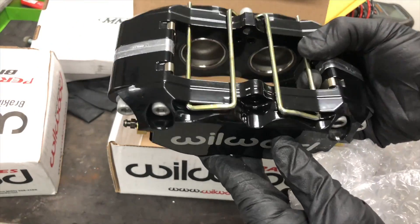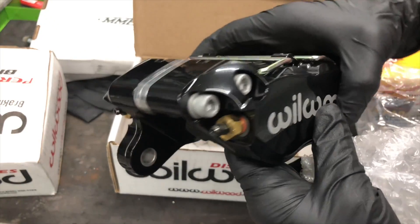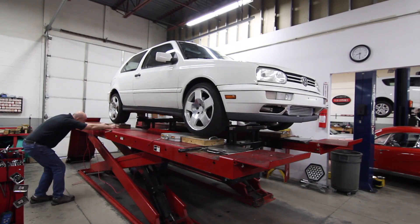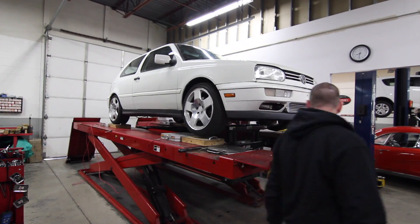There are probably situations where balancing doesn't need to be 50-50 — for a normal street car, it's not a huge deal. But if my number were 48.2 instead of 49.16, we would have made an adjustment. If you change a wheel and tire package, yes it changes the vehicle weight, but you're making a global change to all four corners. If you do brakes front or rear, you're making a change to left and right simultaneously, so you won't throw one corner out of balance — those are things we'll look at in a future video.